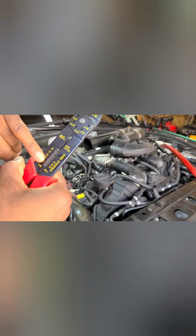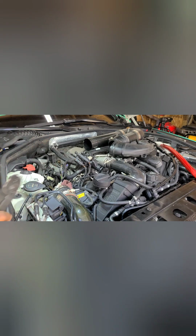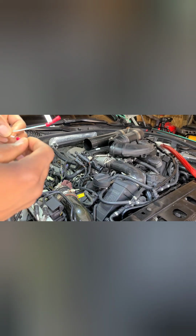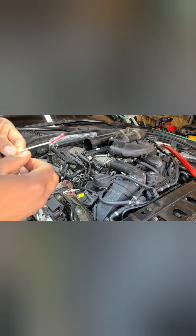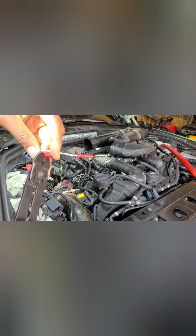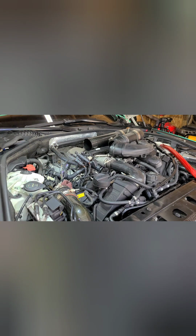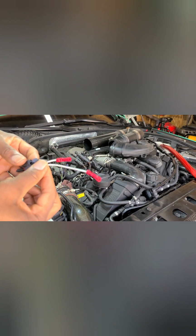So you're using the red one. Then on here it shows you if you're using the red one here. So you got red, blue, and then yellow. And this also has wire strippers on it. But I like the tool that I use. Personal preference, I always crimp it twice. This side done.